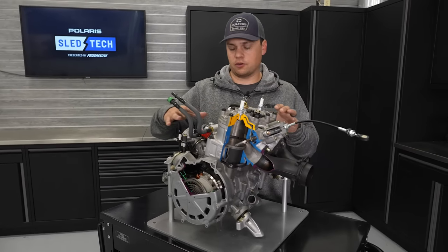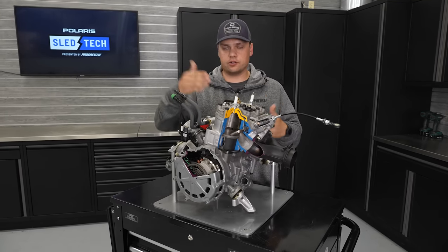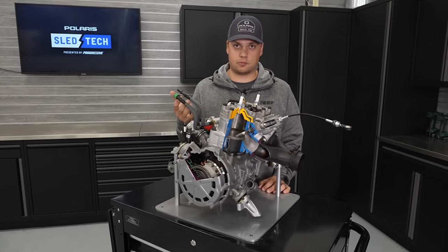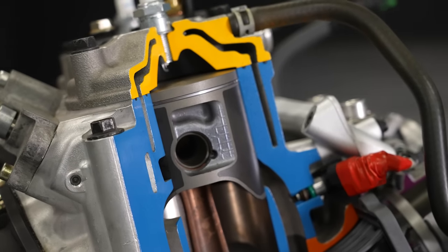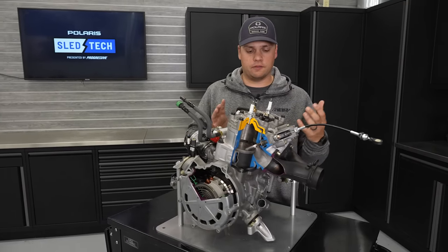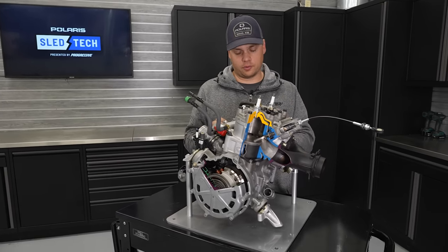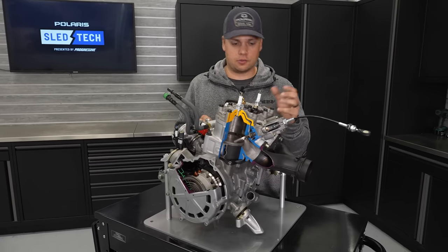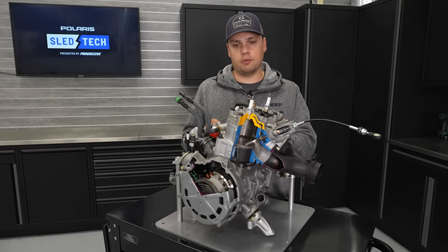Walking through the big performance upgrades: first, it's got a five millimeter wider pitch, meaning the cylinders are five millimeters wider apart. That allows for more flow between the cylinders, more flow in the ports — that's more power, and more power means more airflow, it's as simple as that. The bore is still an 85 millimeter bore like it was on the 800 HO, but the stroke is four millimeters deeper. The 85 millimeter bore with a 74 millimeter stroke was really the optimum mix of performance and durability, as well as response and mid-range power. We wanted more mid-range power than the 800 had, and that's what we put in the 850.